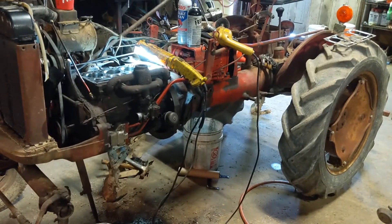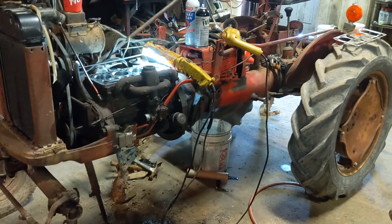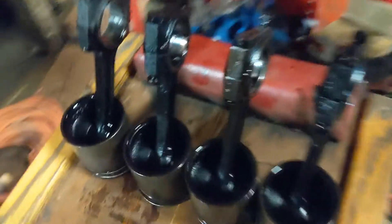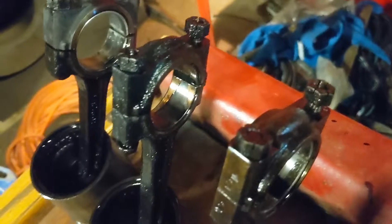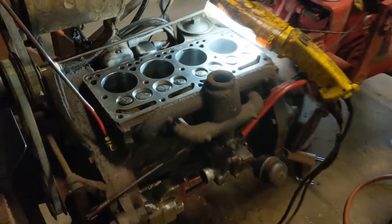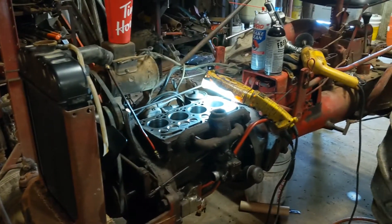So I'm waiting on parts for this thing now — I got all sorts of stuff coming for it. All total for all the engine work, I even bought a new carburetor for it too, and I only spent about $300. That includes the flex hone I'm waiting for, because I don't have one in this size — it's a 2 and 5/8 inch bore. The hones I have just suck; I don't want to spend all day honing this thing. I got new rings and everything coming. Look at these rod bearings — they were just absolutely shot. Didn't do anything to the crank though, which is good, so I caught it just in time. The pistons aren't all scuffed up, so I think I'll be able to hone it out, put all new gaskets and bearings on it, and go out and have fun with it.